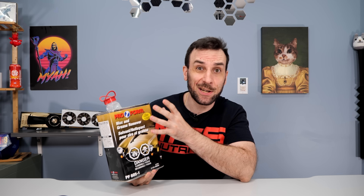The second method I actually grabbed from Lumi's channel — he's an extreme overclocker, go check him out if you're interested in these kinds of tips and tricks. This is the stuff I use: it's an automotive wax and grease remover I've had in my garage for about 20 years. I would say it's not as strong as acetone or paint thinner, but it's stronger than rubbing alcohol. Think of it like this — if you put it on a rag and wipe it on your car it won't eat through the clear coat, but if you wipe it on a wall it will take the paint off. I haven't tried acetone or mineral spirits, but automotive wax and grease remover is what I use and I know it to be safe.